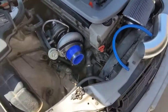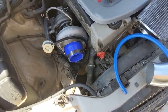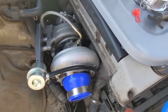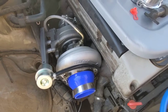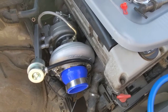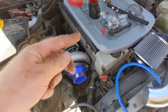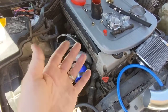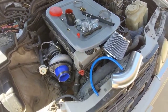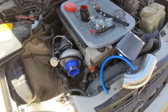For first startup, being that this is a new turbo — they come pre-lubed — it's always a good idea to make sure you get it lubed before you use it. You can do that either by just pouring some motor oil in right here. The other way, which I think is easier, is to start the car without the glow plug — so you know how usually you put the key in and turn it and wait for the light to go off on your dashboard? Just put the key in and turn it right away. It'll crank for a while like a dry crank — it's not going to start because the glow plugs haven't been warmed for long enough. That'll give it a chance to get oil all through the system and oil it before the engine actually starts and you have exhaust gases which are going to turn the turbine. Hopefully this video makes sense — sorry it was a little bit long, but it's hard to do this one-handed and I just want you to get a general idea of all the components and how it's all set up. Thank you very much.